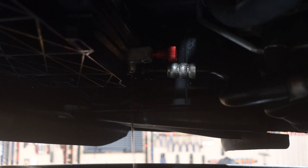If I was you, I would actually drive the car, let it warm up, let the coolant get around the system — otherwise you'll end up like this if you try and bleed it while it's cold and drain the system. Where it ain't worked itself around the engine, it's all just sitting everywhere. Let it work itself around, and when you pull it, it should come completely out in a nice steady stream and not like this.